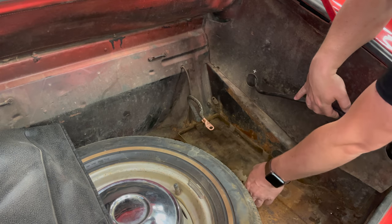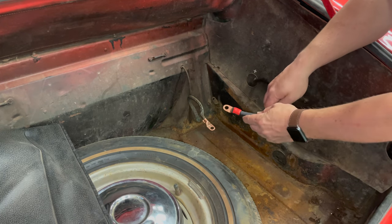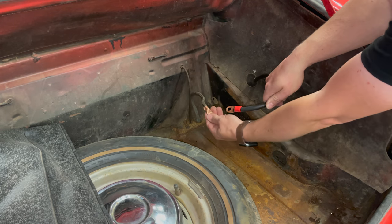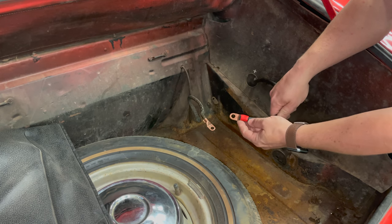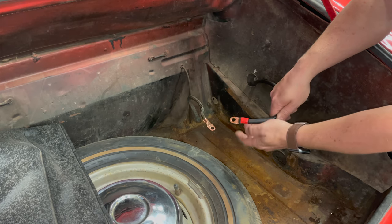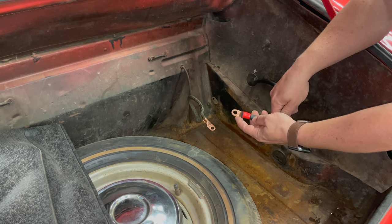Here's the normal location of the battery. I won't need this battery tray anymore. Since the battery terminals on this car were already shot, I went ahead and crimped on some ring terminals on the ends of these cables so that they can be bolted directly to the ultra capacitor. They do make screw-in terminals so you can connect to normal battery cables for an even more direct swap, but since the battery terminals were already in bad shape, I just went ahead and put on ring terminals.